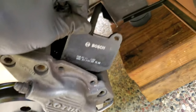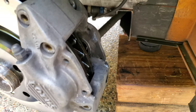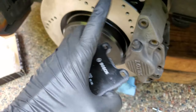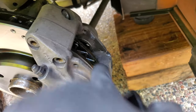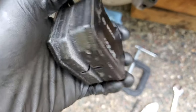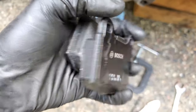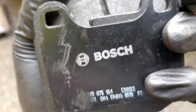Now it's time to pop the brake pads in. We had quite an issue trying to get those brake pads in — they simply would not go in. Yes, we were able to shove one brake pad in, but the disc would have been completely seized even with just one in, because there's just way too much material on this pad. We can't get the brake pistons compressed any more than they already are — they're pretty much already maxed out, with just any residual brake pressure pressing them out slightly. These pads are just way too thick. And they kind of marred up when we had to get them back out. So we're going to have to find a different manufacturer. It seems this company has Bosched up their manufacturing quality.